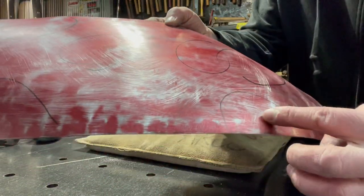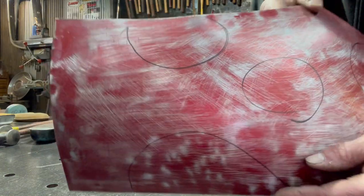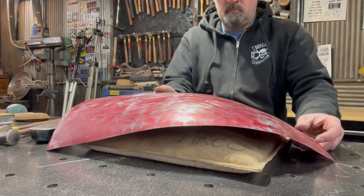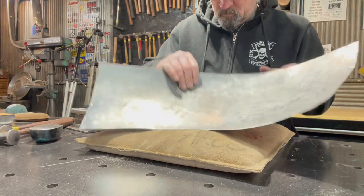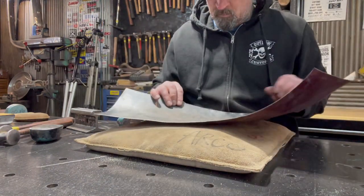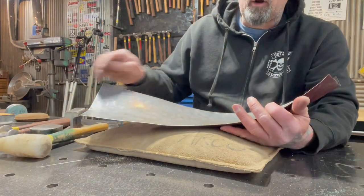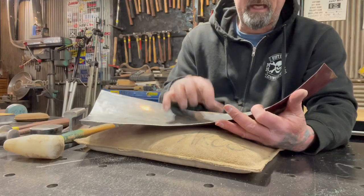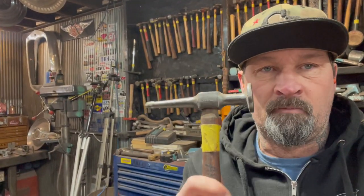I went ahead and circled the spots that need work with a sharpie, and I'll go ahead and hammer for a little bit. When I say hammer, I'm not talking about slamming down trying to form the metal — this is 20 gauge sheet metal, by the way. I'm talking about bumping hammers, body hammers. I'm just going to bump the metal and try to knock it out smooth. It's almost like a radius on this fender — by forming it, I'm putting shape into it.